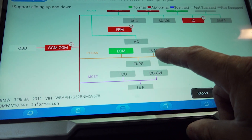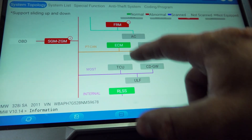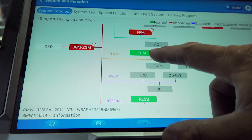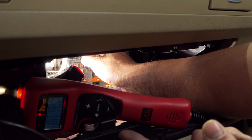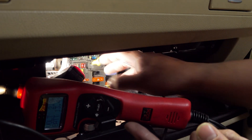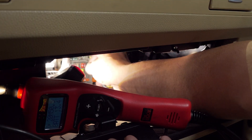There's no wonder it won't crank because it won't see whether it is in park or neutral. I want to find out what's going on on the powertrain CAN. Our powertrain bus is not down because we can speak to the ECM, unless there's another way for the OBD to have a connection to the ECM or the DME. So we've got our relay right up here in that corner. I'm going to remove it and see if it clicks — and we got no clicking. So we've got our power probe here, I'm going to carefully front probe it, and we've got power on that. Going to the other side, we've got power on both sides. So either the diagram lied to us, or there's a short to power on there.